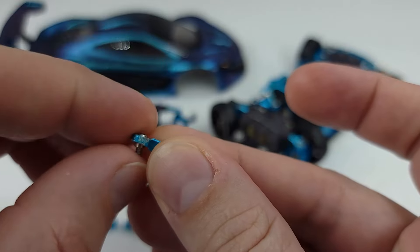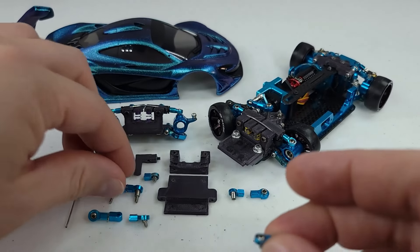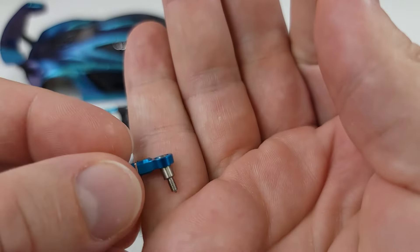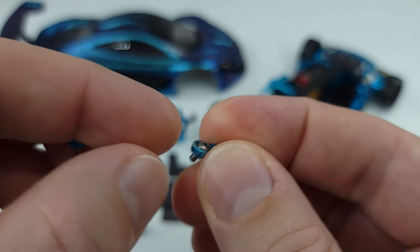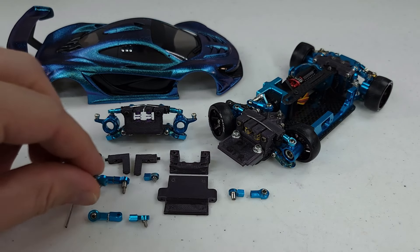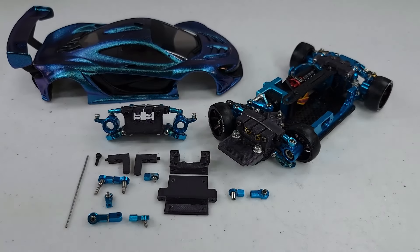Those are something you would need if you want to use this. You could use the newer ones that are coming out, but they're a little bit bigger, a little bit longer, so you really can't use those to adjust the camber very well. I have to use these ones since they're so small — that's the only ones that really fit. And as you can see, I beat them up. I had to make them myself, basically, where I take out the old little ball heads that are in here. I have to rip those out because they're too big and too long, and I have to put the smaller ones in that fit on top of the knuckles, the little wheel wells there.